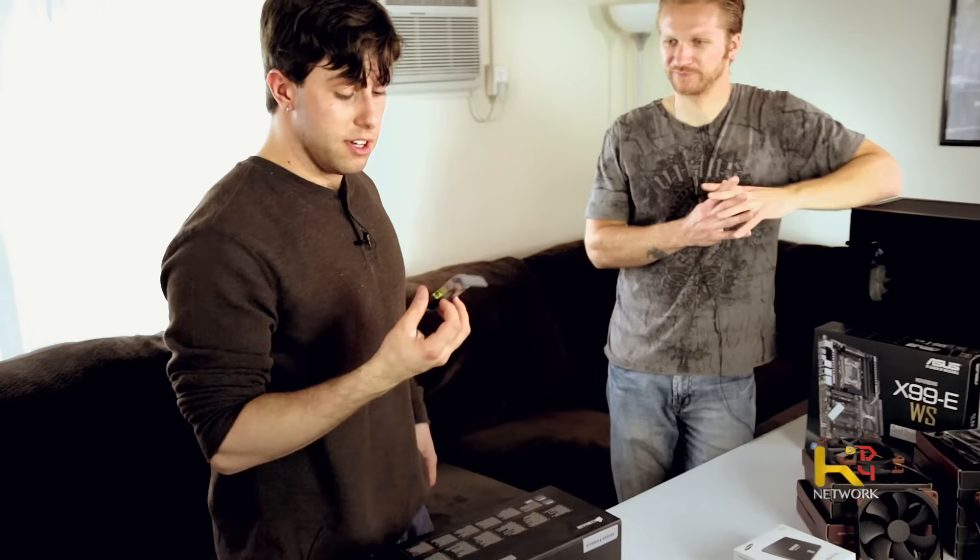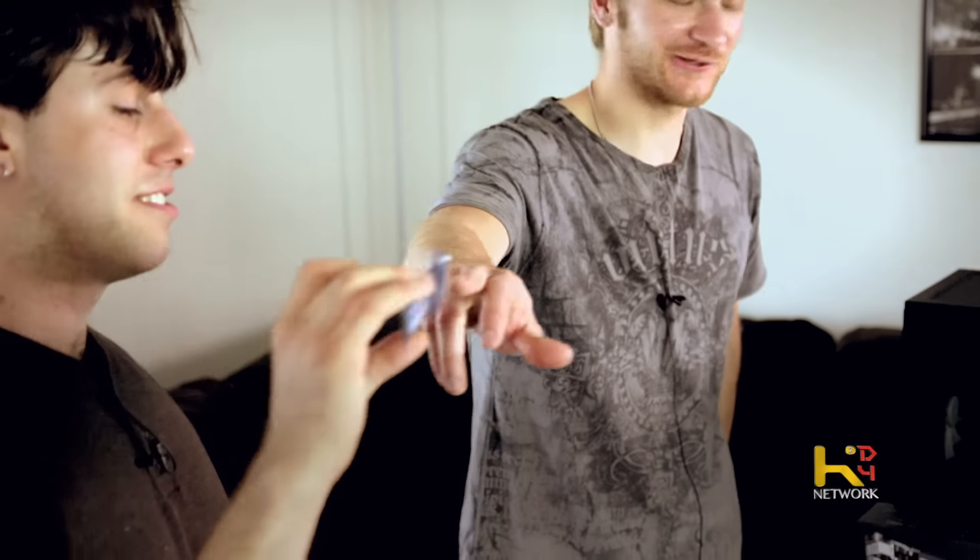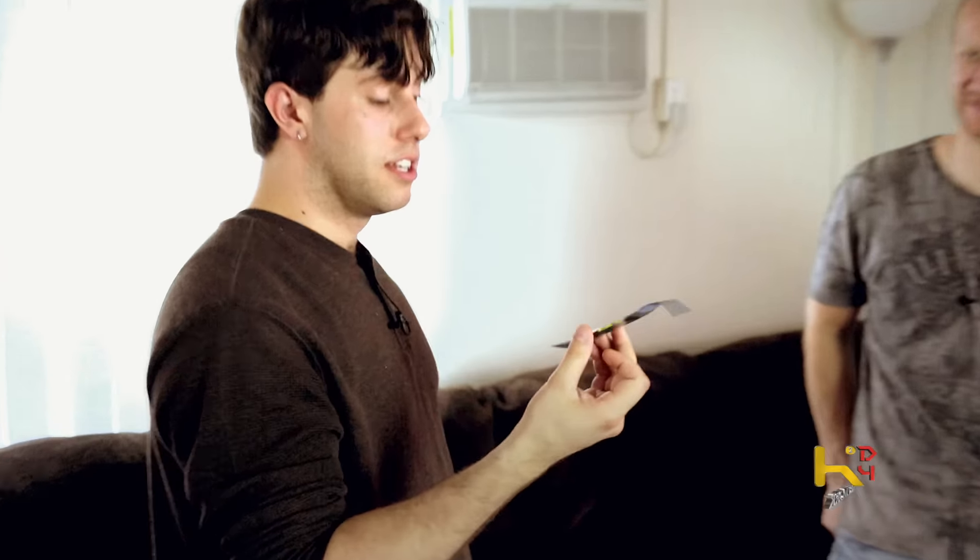For games, I have the Samsung M.2 SM951 — it's an M.2 SSD, the fastest one Samsung made that isn't using the NVMe standard. It still runs on PCIe 3.0 x4 — four PCIe lanes — another reason I chose that motherboard. It's 256GB and reads at around 2,000 MB/s. This is what they put in laptops now — small form factor. It is OEM so there's not a lot of support for it, but I'm confident I can get it to work.